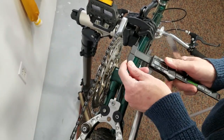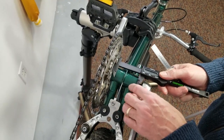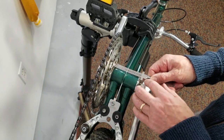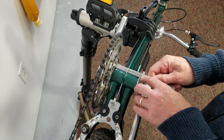With this bike I can't get the calipers in there, so these are not the right tool for this one. If you've got a small ruler you can stretch it across there — make sure you've lined up your zero on the paint right down here. That gives us 68 millimeters.